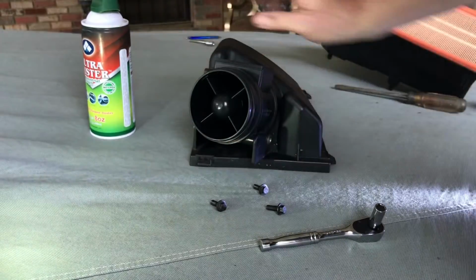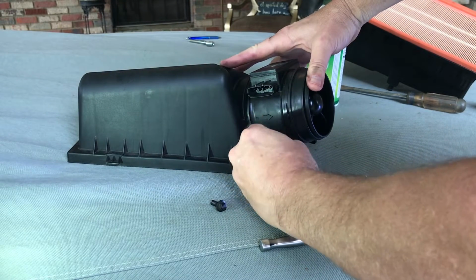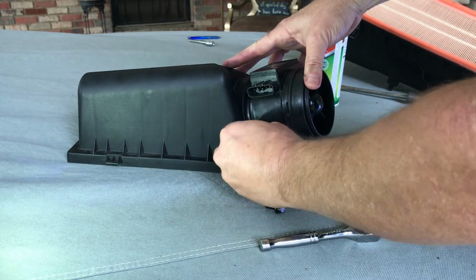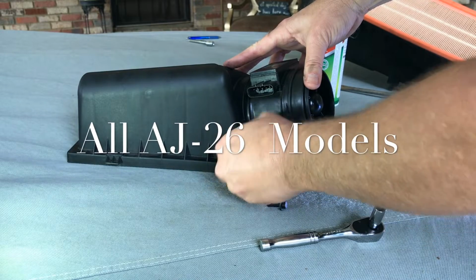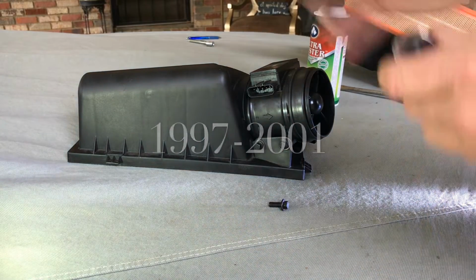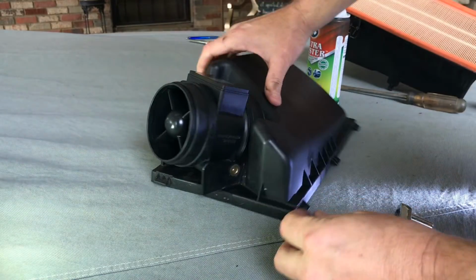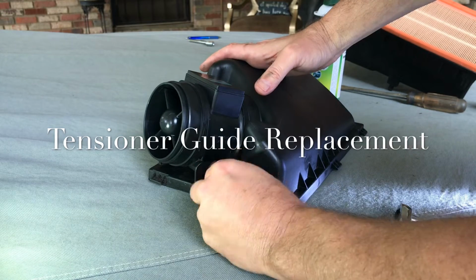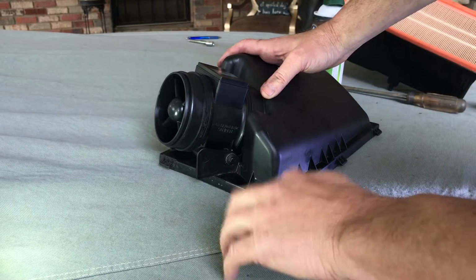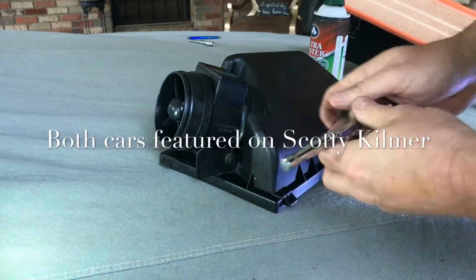I wanted to add that on my channel, I'm a Jag enthusiast. I love these cars. If you keep these cars maintained, they'll run forever. But you do have to do some other things, like between 98 to 2001, these XJRs, XJ8s, it's called an X308 is the body style, and the engine is an AJ26. These cars had failures on the timing chain tensioners and guides. They were made of bad plastic, so I had mine replaced. You can also go to my channel and see the replacement. Everything on this car has been replaced. Also, what I'm sitting on right now is a 1981 special edition turbo Trans Am, so you might want to see that on my channel too.